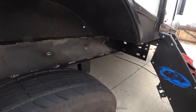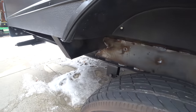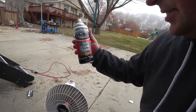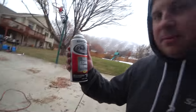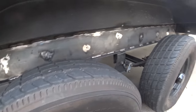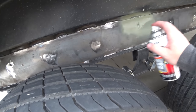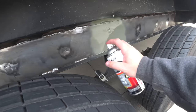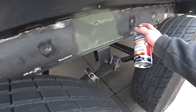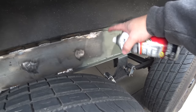Here's where we left off last night — the plates have all been welded on. My welds don't look as disgusting as I remembered. This Rust-Oleum self-etching primer — you can find it at Home Depot — is the only thing I put on raw metal. It chemically etches into the metal, so it's more than just sticking to it.